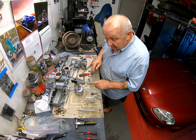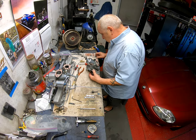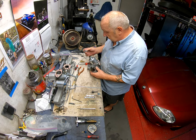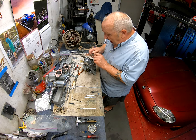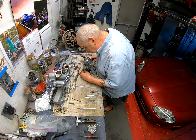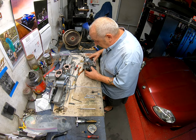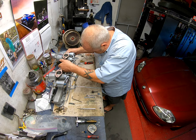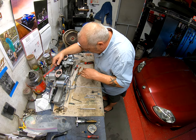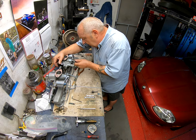All right guys, I'm going to stop the video here while I repair this and then I'll come back. I'm an angry bunny. Now I've got to find out which way around this throttle return piece goes - because if I put this on the wrong way... yeah, it's got to go on that way, no two ways about it, because the spring hooks onto that. So now this will reside on here, and then this carb is in the way for my other stuff so I'm going to backtrack and take this off - sorry about that guys.